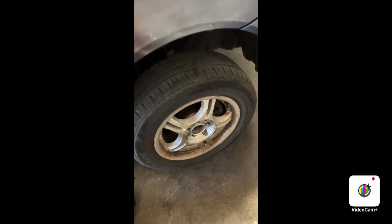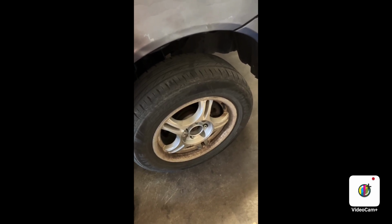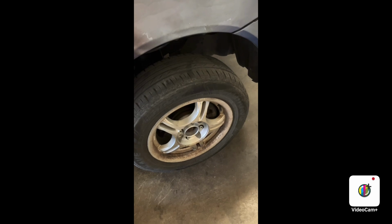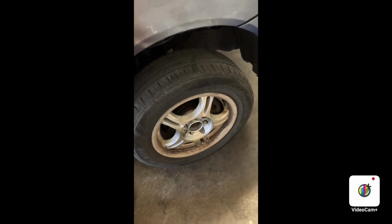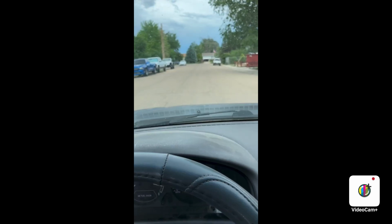And then the tires go back on. I like to give them a quick zap with the impact wrench before bringing them down. Remember, put your car in neutral before bringing it down. Nice to the transmission. Ooh, it brought it down, and I like to torque them down to 100 foot-pounds. Well, looks like it's time to go take her for a little test over to go get an alignment done.